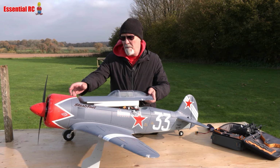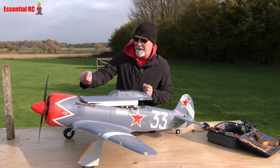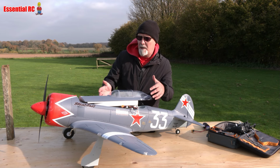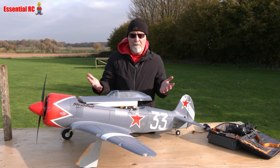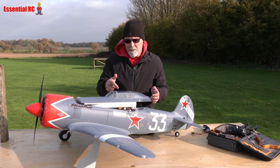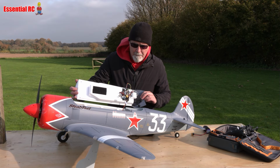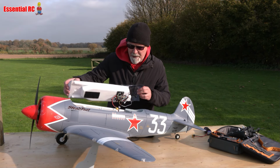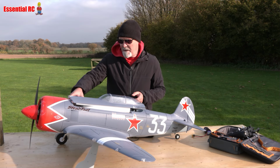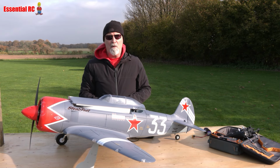But of course, on a model like this, you can't have the pitot tube for the airspeed sensor on the fuselage, because it would have the flow from the propeller. It would have to go out on the wing. So I will probably do that in the future, and route the cables into the flight controller here. I think that's going to make it quite a lot more interesting. Put the second battery in to power this, rebalanced, and I think we're all ready to go.